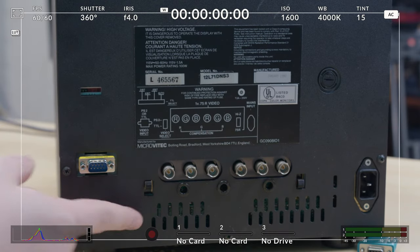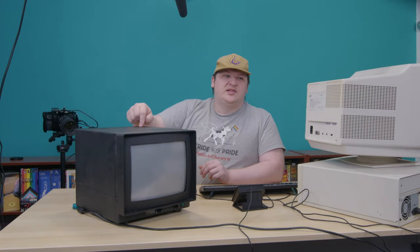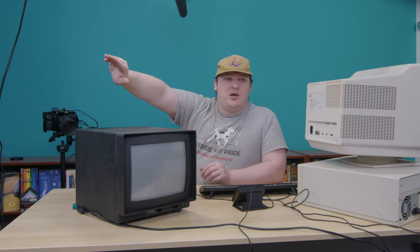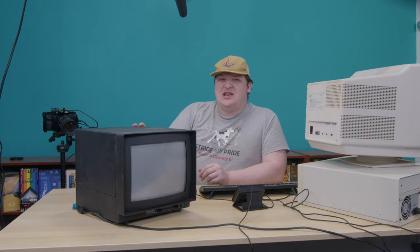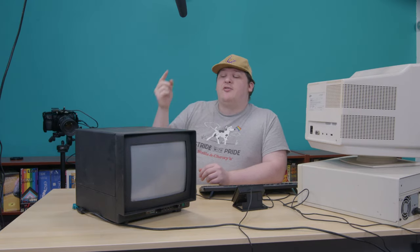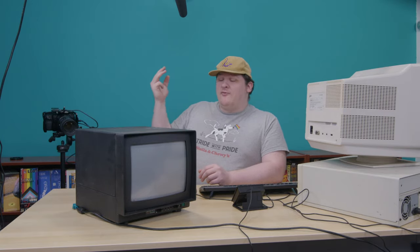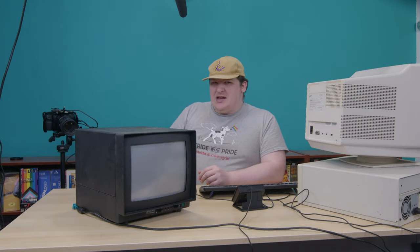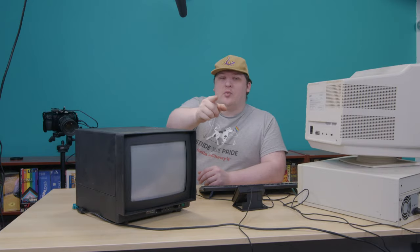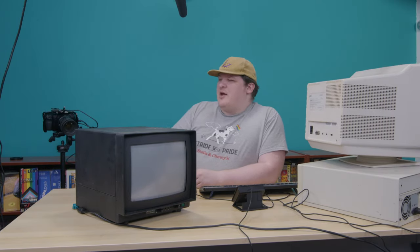This switch here flips you between analog and TTL. So that's the really cool thing about this monitor. This one can do all that stuff I was talking about in analog as well. So yes, it'll do TTL. You can do TTL from a CGA card, an EGA card in either mode, a BBC Micro with its weird format, or Acorn Electron, same thing but different, the PC88, the PC98. And then, I'm sorry, I left out the Commodore 128, which also used RGBI. Maybe I'll fire that up here if I have time.